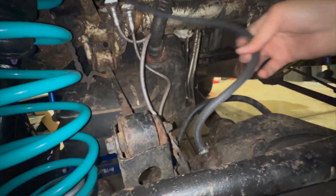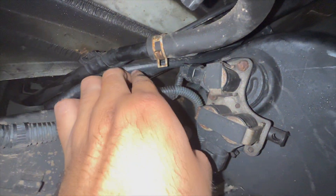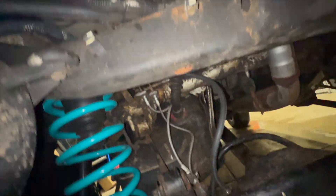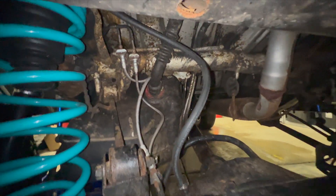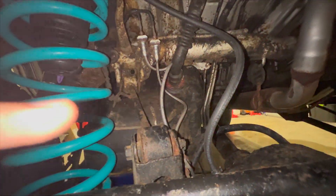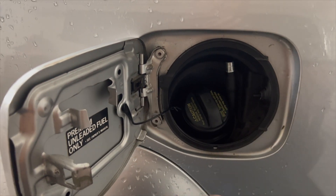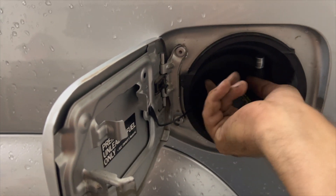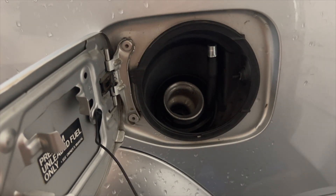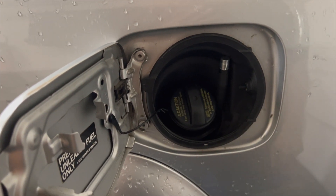You will have some extra hose. I'm going to use some zip ties and tie it up — especially up here to the existing fuel line — and just make sure it's away from the spring but has enough slack so when it does articulate, it does not get too short. I've got this nicely tucked away, no issue with closing it, and I can open up my fuel filler, fill up, and put this back in with no issues.